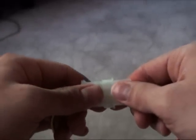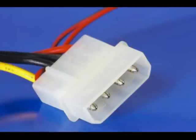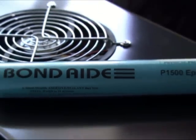Another option is to swap the plastic connectors and socket parts with ones that fit easily without alterations. Secondly, Molex connectors are made of either nylon or polypropylene. No glue will stick to that. So whatever anchoring means you choose, it has to be mechanical. For this task, I chose epoxy putty.